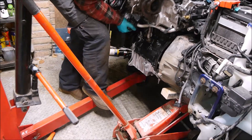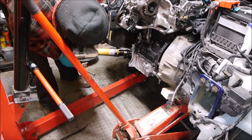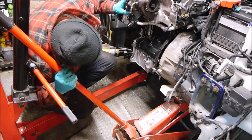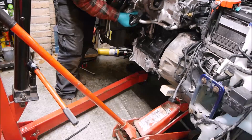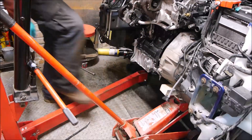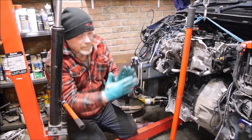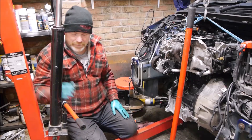We've got a combination of lifting the engine and the gearbox now - that's about level. After much frustration we finally got the engine in. It was actually hydraulicking on the slave cylinder - the slave cylinder wouldn't let it go in, so we bled that off, the slave cylinder compressed, and the clutch finally went in. We've got one engine mounting, one bolt in, and we're happy. We're going to move on from there and put the rest of the bolts in.